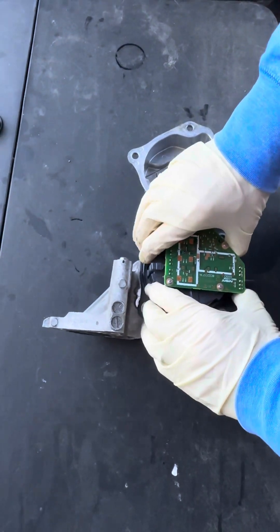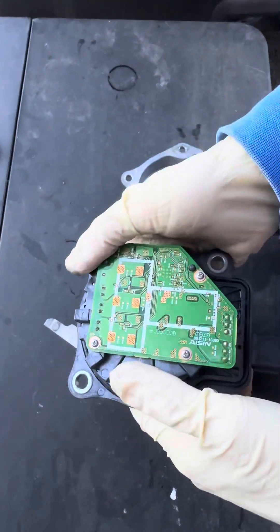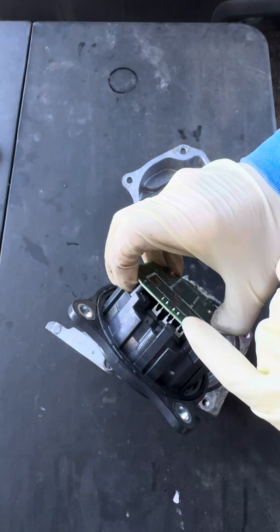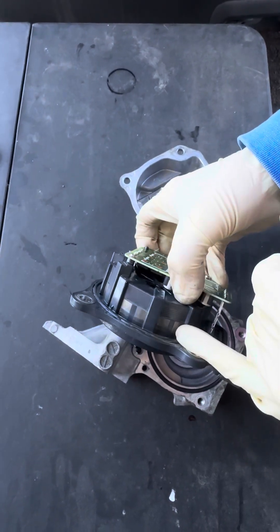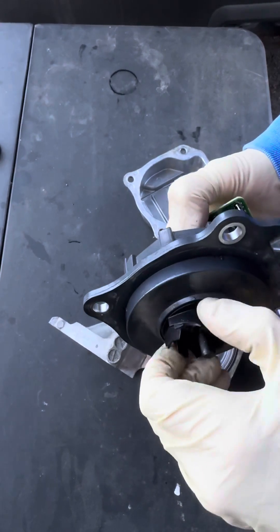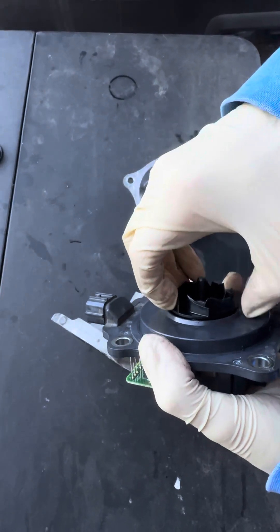This is the circuit board. This is a brushless motor, and we have power and ground coming in, plus control wires similar to a CAN network. We've got three-phase power control for the field winding, which gives the magnetic field energy, like an alternator, to then wirelessly turn the impeller.